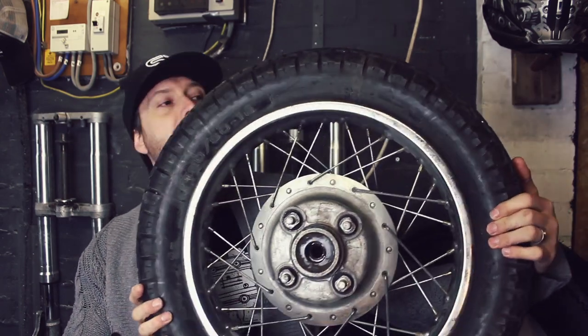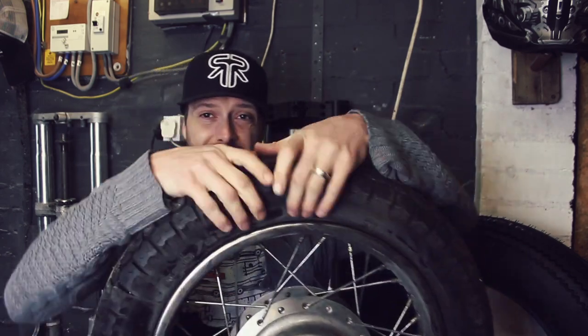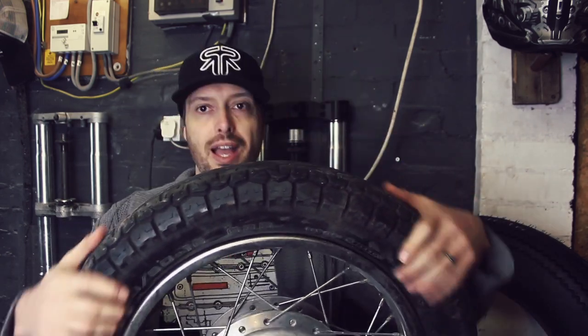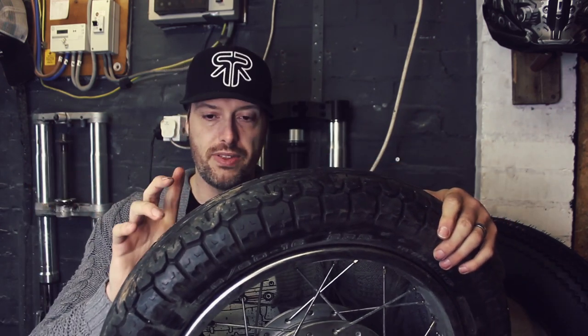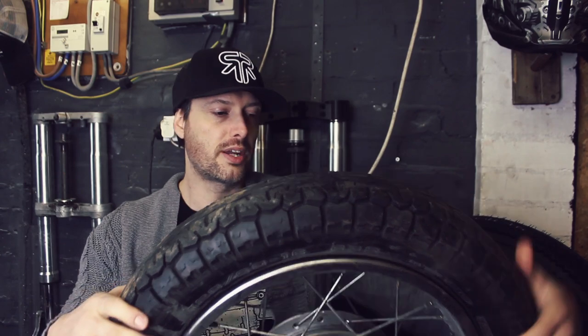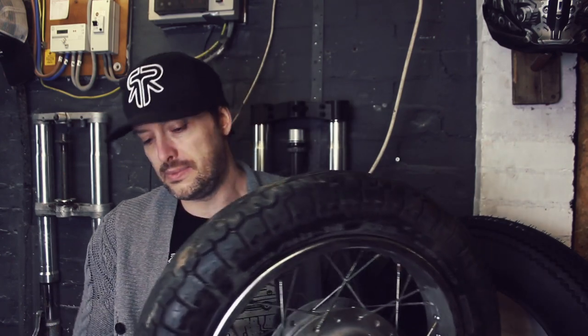The current ones? Yeah, they're average. Reading it out, it's a 120 tyre, 16-inch rim — so 120/90/16. The 90 profile looks fine; it's a chunky profile still because it's a 120 tyre and 90% of that still means it's fairly chunky. But I think we can go chunkier than that. And so the question is: what tyre do we put on the Mongrel? And this is the solution.